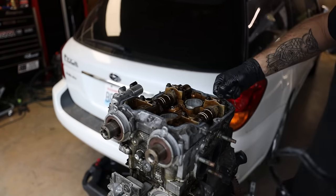As you guys can see, make sure there's obviously no physical damage. Make sure the cams rotate by hand. Everything feels nice and smooth. You need to be very careful at this point, because after you take these cam caps off, you need to make sure you do not turn this engine over or spin the engine stand. If these valve buckets underneath of these cams fall out, you are totally screwed and you have to figure out what bucket goes where.